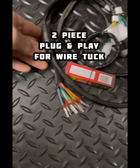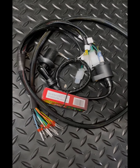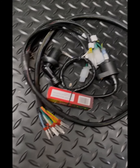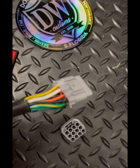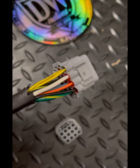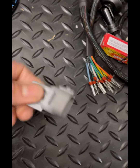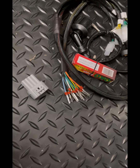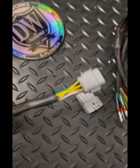Right here is the back half of the harness — it has the coil, the stator plug, the tail light, and auxiliary once the key is on. This is the middle part; we've connected it right here. We've already pre-pinned it — we've already pre-pinned the back, but we haven't put on the connector. That way our customer can receive it, put it through their frame, and have a clean wire tuck and service their bike easily.